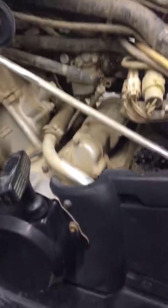With stock jetting, it's not gonna run like you want up in elevation, running up in the mountains, climbing hills, or anything like that. So we need to go ahead and pull that carb out, get a jet, drill that welch plug so we can adjust that mixture screw to get her running a lot better for you.